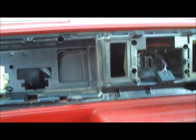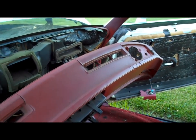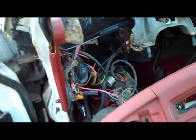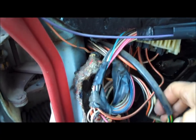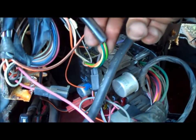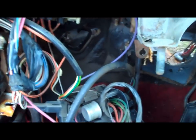Looks like I'm pretty much ready to pull this dash out — I'll do it with one hand since I'm holding the camera. Here it goes — it is all coming out, and there you go, the whole thing just drops right back in your lap. That's how you pull the dashboard out of a G-body. As you can see there are a few things to disconnect because a lot of wires run up through the body — like the rear window defroster, the courtesy lights, and the rear tail light harness with the colorful wires right here.